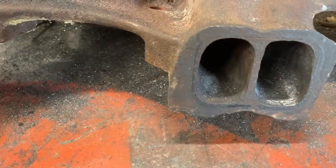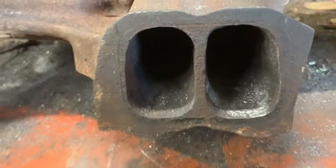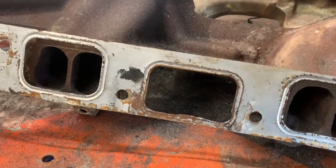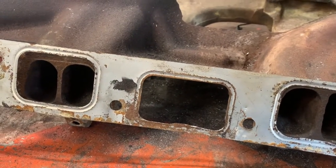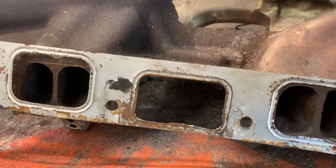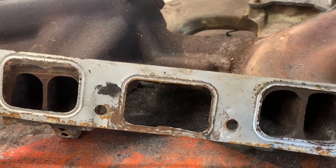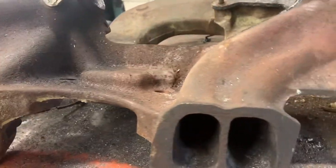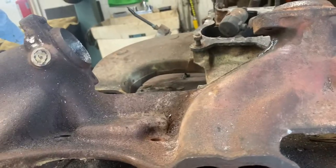I guess I am going to do the port side today after all — I've got a little more time. All we're doing here is taking the gasket — I'm using the old gasket — and going up to the manifold. You hold it up to the head, bolt it down, scribe it, and then just grind to the line. All we're doing here is the same thing — just grind it out to the line.